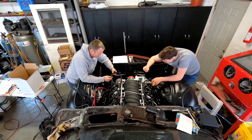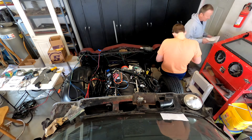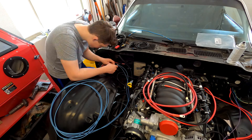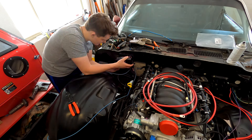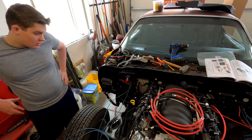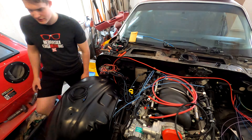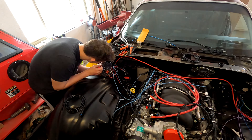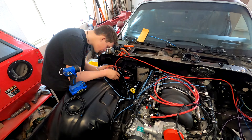You can see that he's wired up some of the headlight circuits. Now we are starting to attach a lot of the engine harness. You can see Dillon is working on the engine fuse relay box. We made several modifications to this box, including fixing the way the relays were wired from the factory — they were wired with the relay positive and negative connections reversed. We also added a second relay to power a second cooling fan next to the radiator, and added fuses for our air conditioning and that second electric fan. There were a number of modifications to that fuse relay box, but what we ended up with is a very clean look where it could have come that way from the factory.